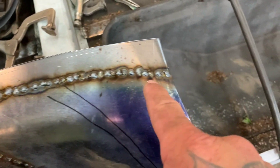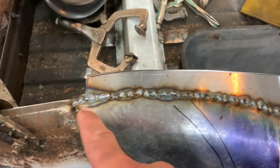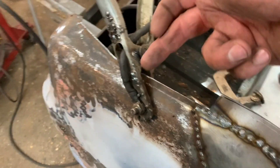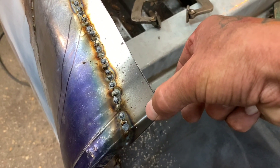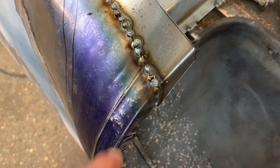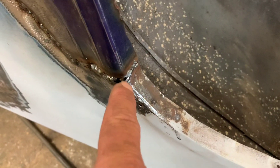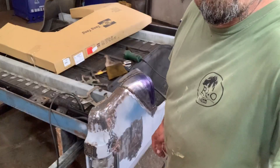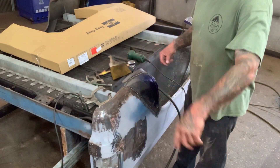I added a piece here because I looked at the other side of the bed and realized that one over there is cut off also. So I'm going to do these where they look correct and then run this line straight through — adding about a half inch to three quarters of an inch and then cut that off. I'll take a hammer and dolly and put that body line in there. I've got some small dents to get knocked out too. And then I'll start making the piece for this. Now I'm going to cut this piece off — wear your safety glasses, don't be a dumbass.